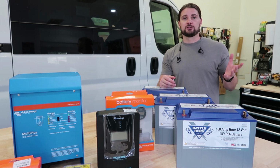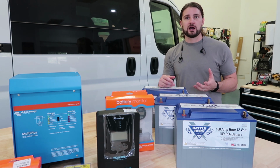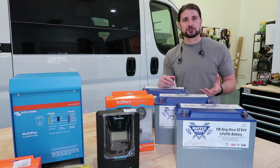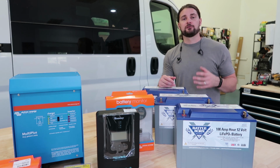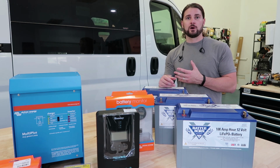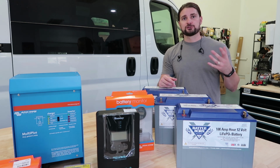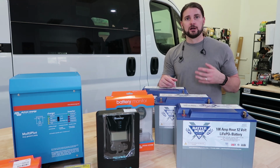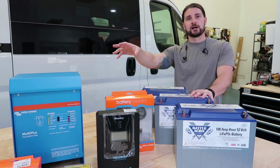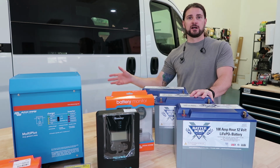Additionally, besides the 12 volt system, you have your 110 system. So the Bosch 2.5 gallon hot water heater that we'll be putting in this vehicle so that they can have hot showers, that is going to be coming off of the 110 system. The outlets, like a house outlet that they will have wired into the van so that they can charge their laptops and things, all of that will also be coming off of the 110 system. And the 110 system comes off of the inverter charger. So the inverter actually has to be connected and turned on in order for any of the outlets to work.